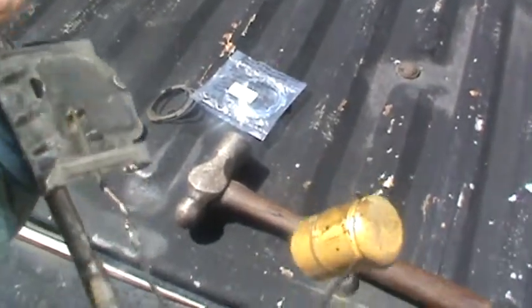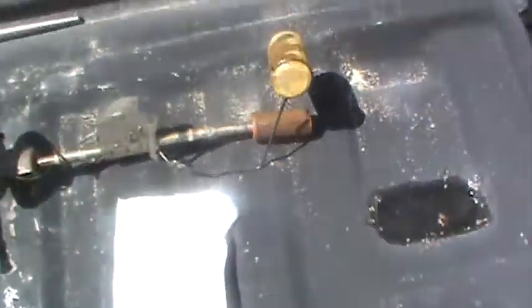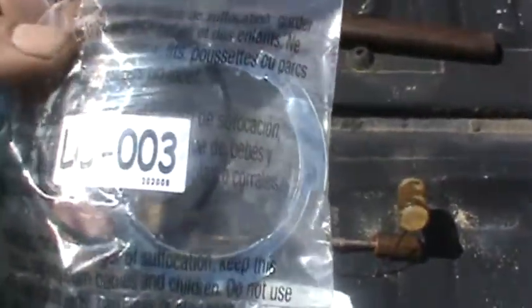This is just a potentiometer — that's how it works. We'll go ahead and take that brass one off and replace it with the plastic float. And here's the new lock ring and gasket for the new gas tank — L003.